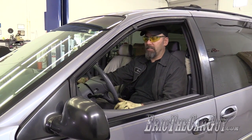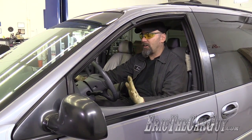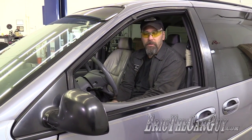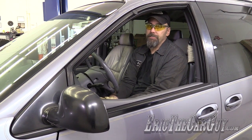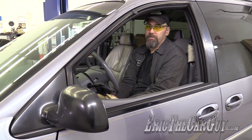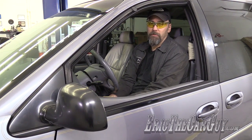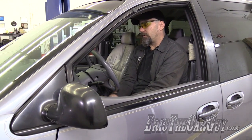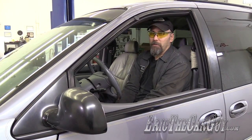I believe this is going to need a transmission based on what I've seen. I mean, I honestly don't need to look any further. With fluid that low in an automatic transmission — an automatic transmission without automatic transmission fluid is like an engine without oil. It's not long for this world. The parts burn up, the clutches don't work, and away you go. I'll post the link in the description to my dissection of an automatic transmission so you have a better idea of what I'm talking about when I say clutches. But based on what I'm seeing here, unfortunately I think we've got to put a transmission in this van.